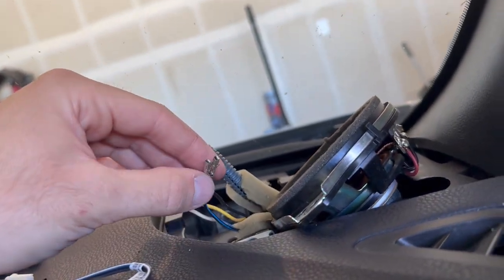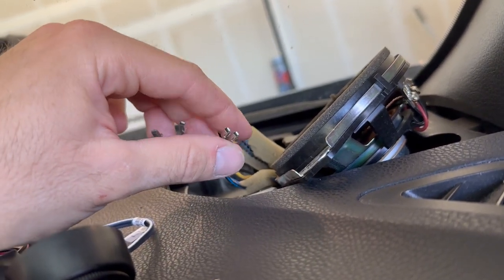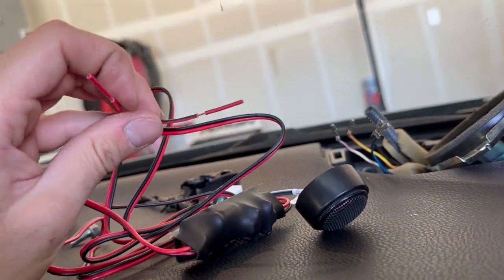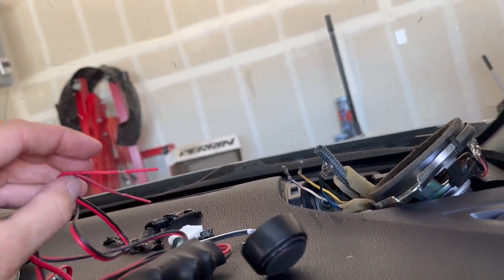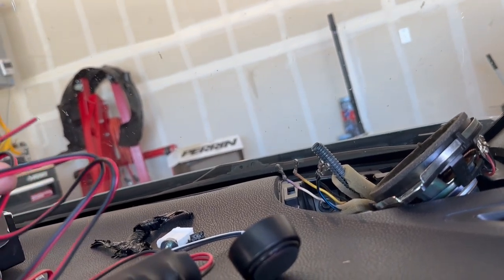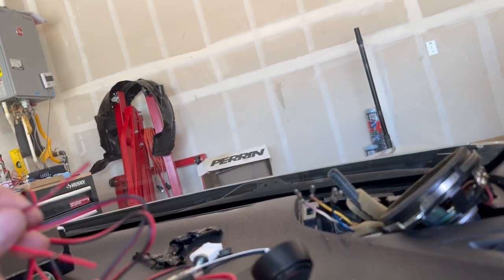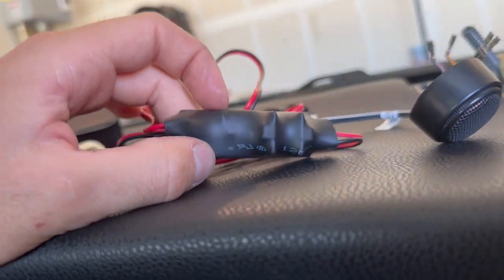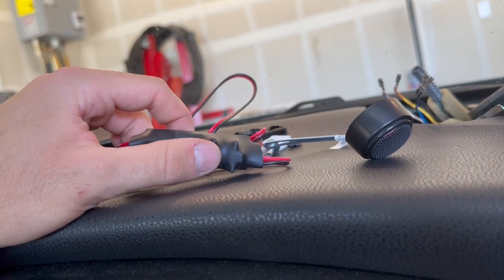On the other side you have the negatives, which is the black with the blue stripe and then the solid black. Those get tied together as well, then you connect them to the negative on the speaker. On this JBL speaker that's the black and red wire. JBL's color coding is a bit odd — if you look at it, I think the colors may have bleached off from the factory, so it looks like a black and red combined. And then you have this box here as well, which I reckon is some kind of amp — I can see what looks like a capacitor on it.